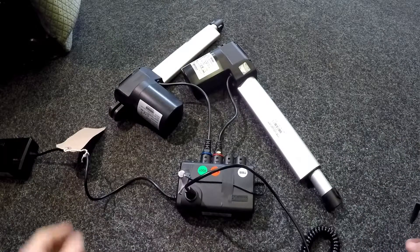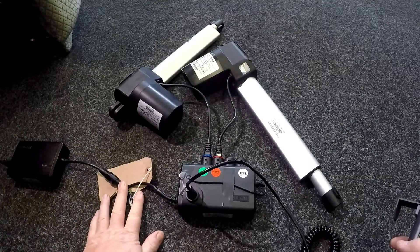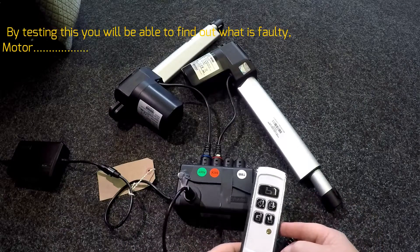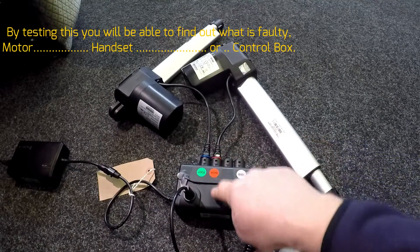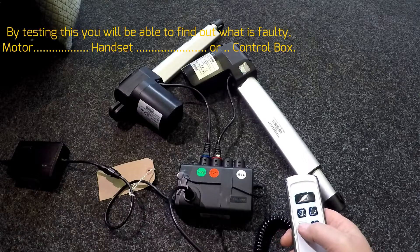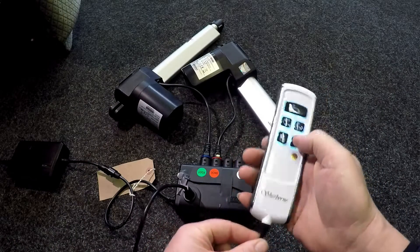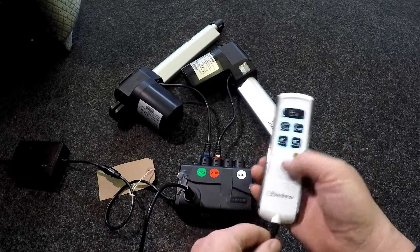Now you've checked your power supply, looms, connections, voltage, and the power light is on — you're happy with power. Some of the buttons on the handset are working, some are not. Say you've had the handset a long time and one button isn't working. The button signal travels through the loom, through the connection, into the motor. We know it goes up but won't come back down. These two buttons are for one motor and these two buttons are for the other. First, move this connection about as you press that button — if it starts to work intermittently, you know there could be a slack connection and you need to replace the handset.